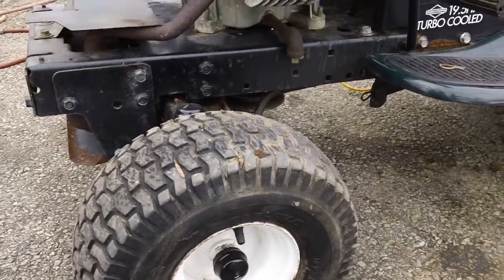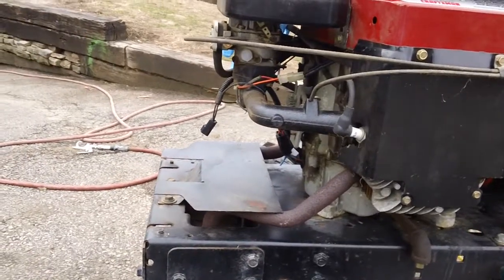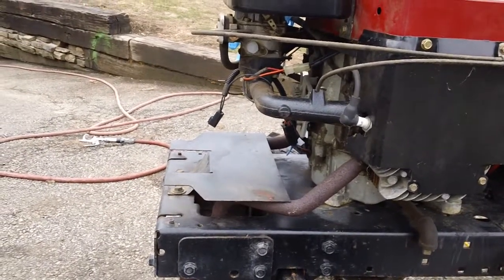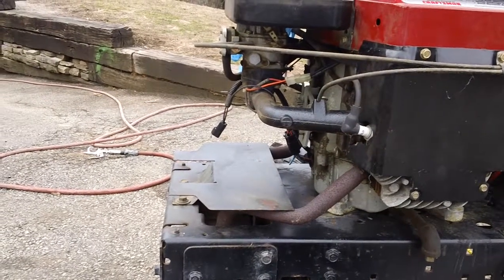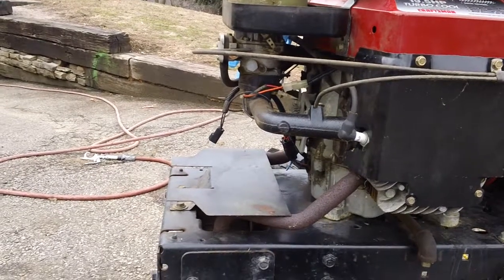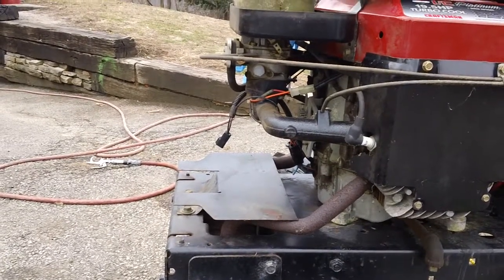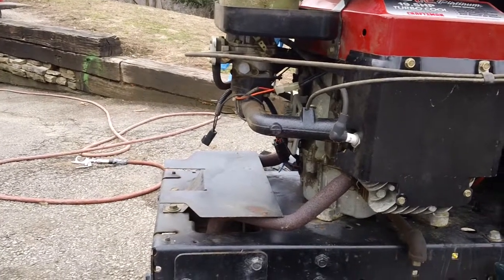The other things were his carburetor up on the side over here. It was not pumping any gasoline up to the carburetor, and it also needed to have the carburetor cleaned out, rebuilt, and have the fuel pump rebuilt as well. And the fuel line was cracked and split up by the carburetor where it goes into the input parts of the carburetor's pump.